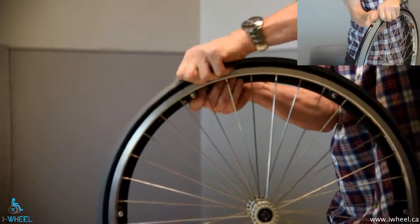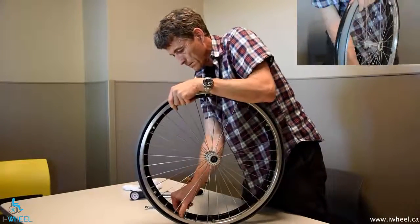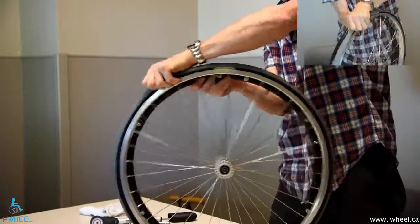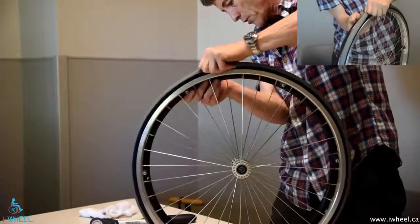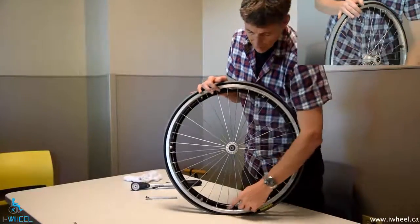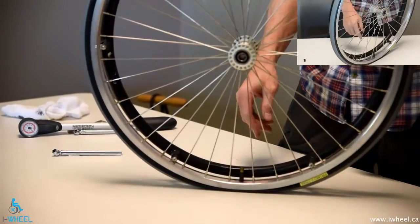I may have a little bit too much residual air and I'm just going to see if I can get any more out. I'm already there, so now I'm just going to make sure I haven't got too much tension anywhere. Alright — valve's perpendicular. We're going to be less likely to have a flat from a pinch, and you can just put air back in the tyre.